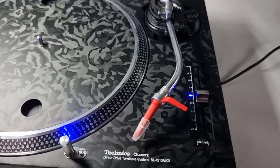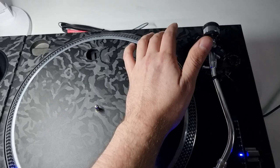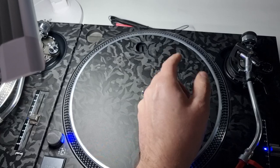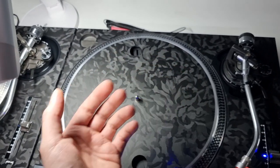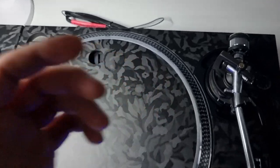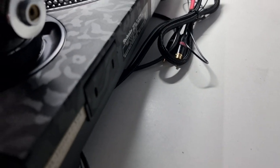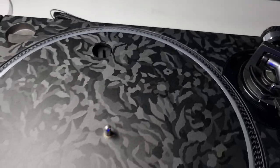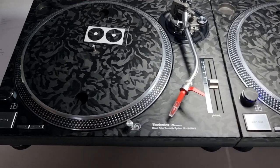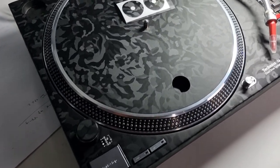The socket section has been polished, everything is done. The sockets themselves for the dust covers were in a very bad state — they were covered in corrosion, one of them was missing. Well they're both missing sockets on either turntable; there was a bag with parts to be put back on. The customer's undecided what he's going to do with his dust covers, so what I've done — what I do with a lot of these — is wrapped the back plates for the sockets in the same camouflage vinyl. It covers over all the corrosion; you flatten off all the corrosion, clean it up, and simply pop the vinyl over the top and cut it around with your surgical blade.